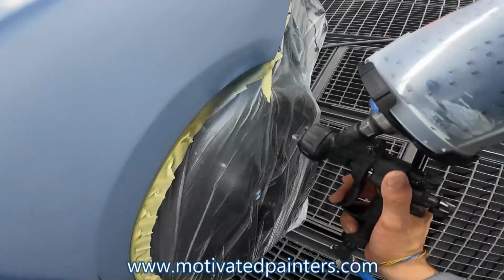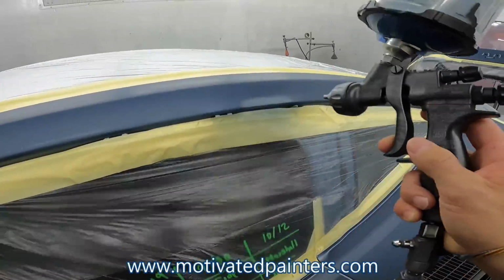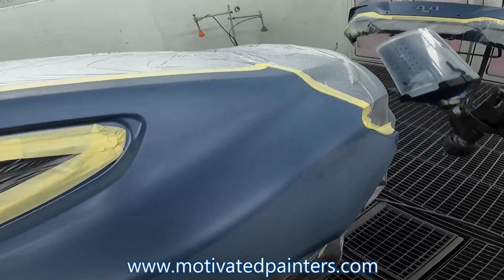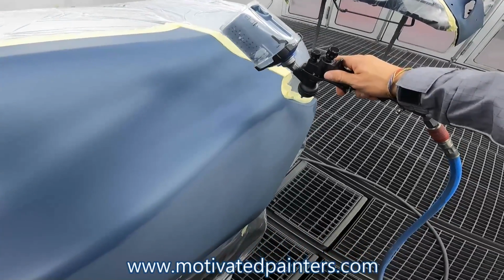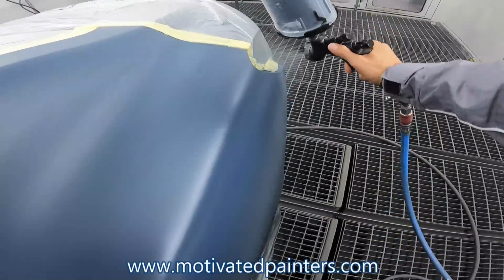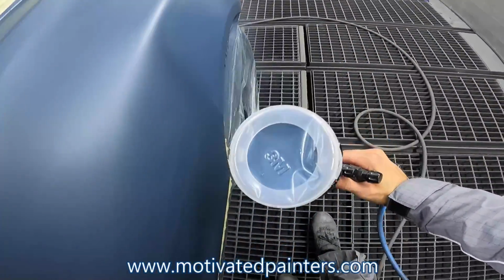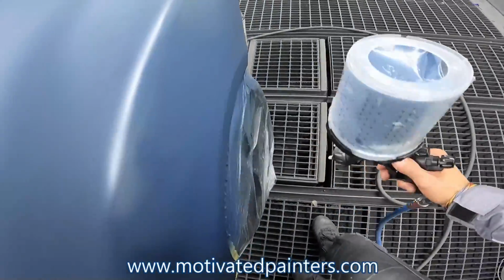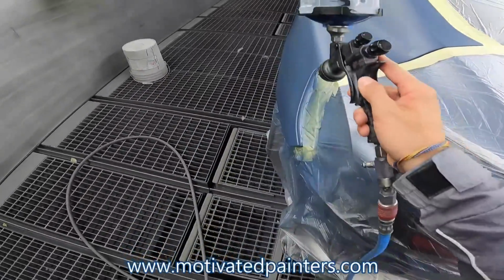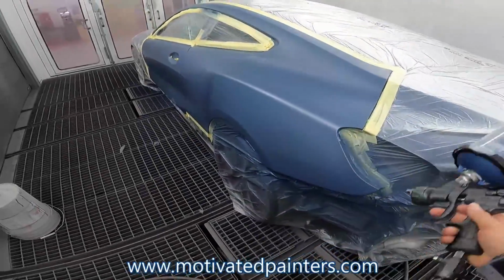A little bit of water primer here, so I'm going to put a little bit on there first just to cover the difference of shades. That's usually what I do, just to get that covered up. Now we're going to aim the gun down, and I'm not pulling full trigger because this is just the first coat. I'm still aiming the gun down because I want to contain the space as much as I can while I'm getting the coverage, and not trying to get overspray up here because we don't have a blend for that.